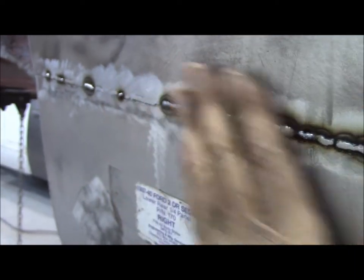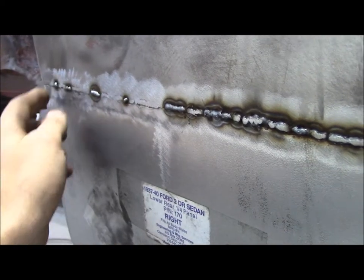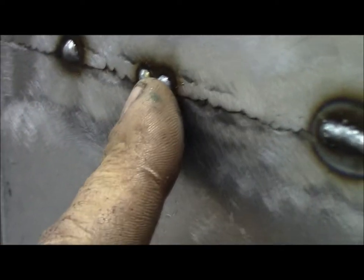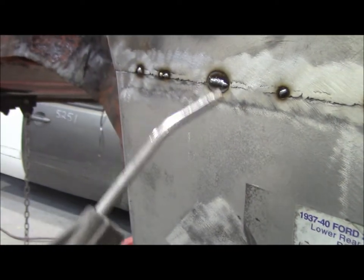A trick when you're welding and putting a panel like this on — for you novice guys — don't try and stitch it up all the way across because you're just going to warp it. Do little spot welds as you can see, and just keep going back and forth. As I'm doing them, sometimes after I get a weld on there I take the air and give it a blast around — cools it down and stops it from getting all out of place. Now just like I told you — old time garage, we're only human — I cut a little too far here, kind of made a mistake right there. But it's not a big deal.